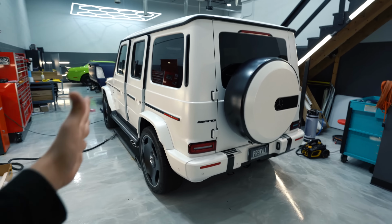So the rain finally stopped, which means it is time to take the Corvette and head home. And I'm gonna end the video here. So I hope you guys enjoyed today's video. I gotta order a wheel and tire setup for the Corvette, because when we were out doing those pulls, traction control kept kicking in because the car was just spinning. It makes way too much power for that wheel and tire setup. So we're gonna get away from the 20s and put 18-inch wheels with 325 wide tires. I'm not sure what brand, I think Mickey's or Toyo's.